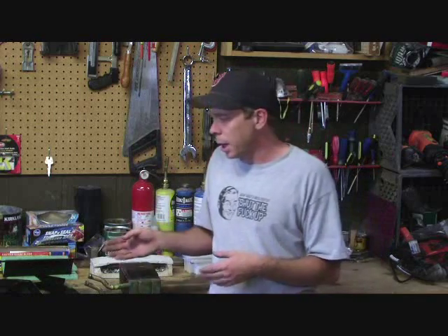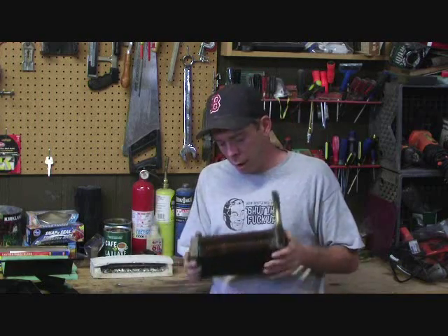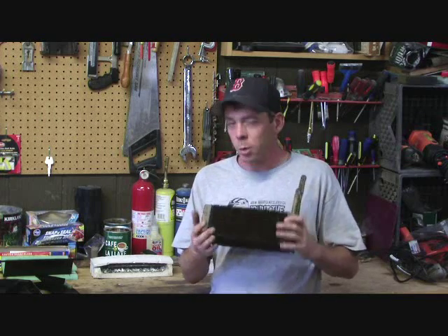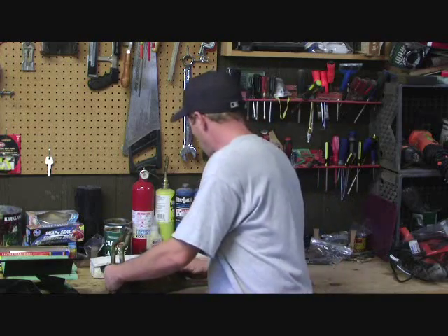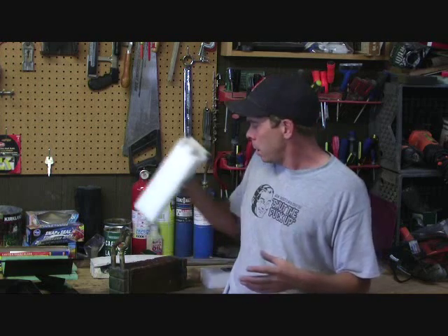Now that we've gone through that, the other thing I ended up having to do was deal with a bit more rust in the box than I anticipated. Underneath all of the soft gaskets and behind the styrofoam, water had gathered and settled in, so there was some rust in there. We went ahead and sandblasted the unit, put a couple coats of fresh paint on it, and the next stage is really reassembly. First thing is to finish cleaning up the heater core. If you're on the extraordinarily anal retentive side, you can also straighten the fins — I haven't seen a radiator fin straightener tool in a long time, but needle nose pliers and narrow gauge dog shedding brushes are great for straightening soft fins like these. We'll end up taking all the pieces we've cut, adhering them to the various places in the unit, starting the reassembly, and after about a couple of hours they should all be put back together again.